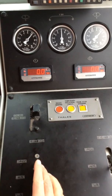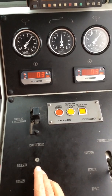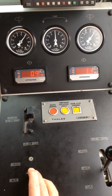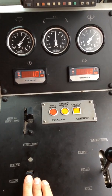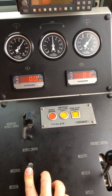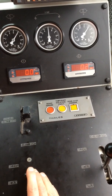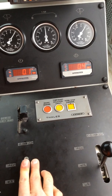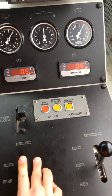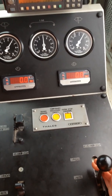I'll repeat the test with the direct. Put small steps in to get to a bar — nice and controllable. Okay, and now I'm going to release the brake. Wheels rolling again, you can have another go. And release. As soon as you sense the wheels are locked, you can go straight to release and get the wheels rolling again. It's something you don't get the option to do with the indirect brake.